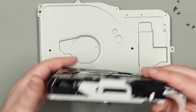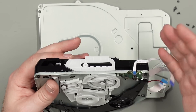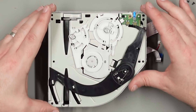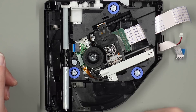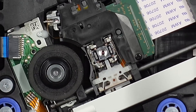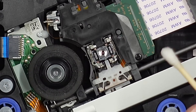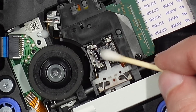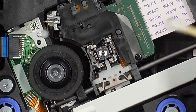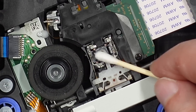With everything disconnected, lift this out. There are just four more Phillips head screws to remove — you don't need to worry about one of them, but make sure the cable is out of its channel. With those four screws out this should all lift straight off. Honestly, first impressions — everything looks pretty clean in here, so I doubt we just have a dirty lens. We'll give it a clean first using 99% isopropyl alcohol on a q-tip, gently going over the laser lens in a circular motion, then drying it off with the dry end. I'll do a partial reassembly and test this out, but I suspect we're going to need to swap out the entire laser assembly.